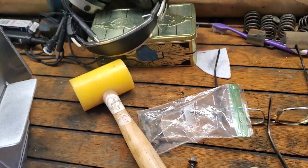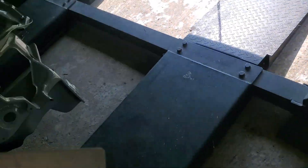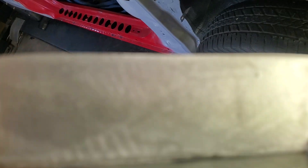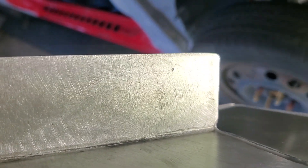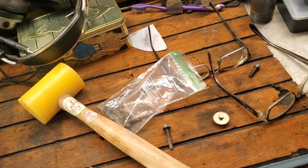That's all I did — really light. And as you can see, there it is. See that little pinprick? Now I know where to drill. Guys, it's that simple. When you got a blind hole, that's how it's done. That's how I do it.